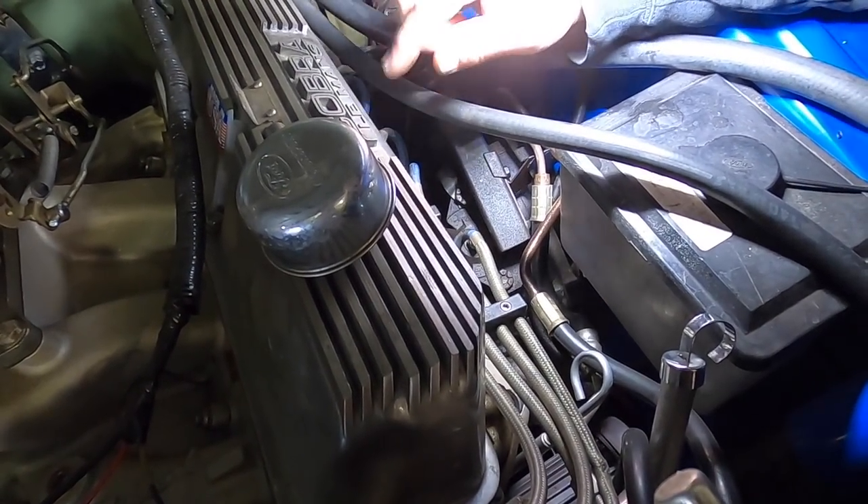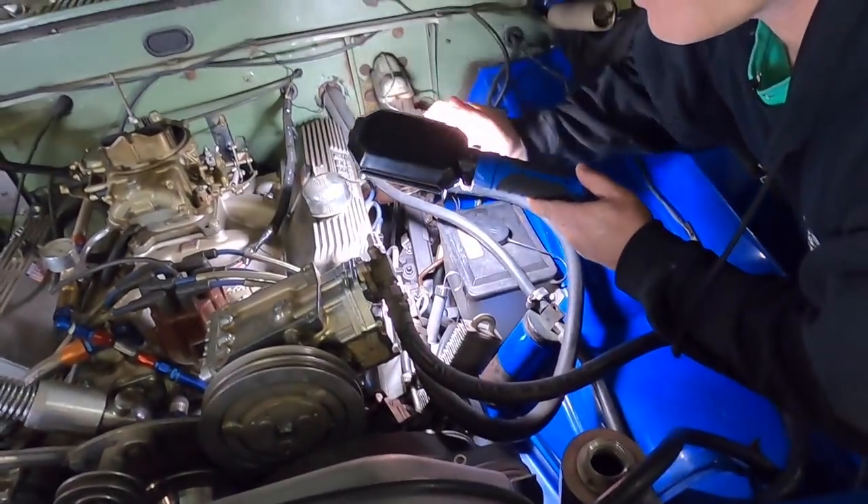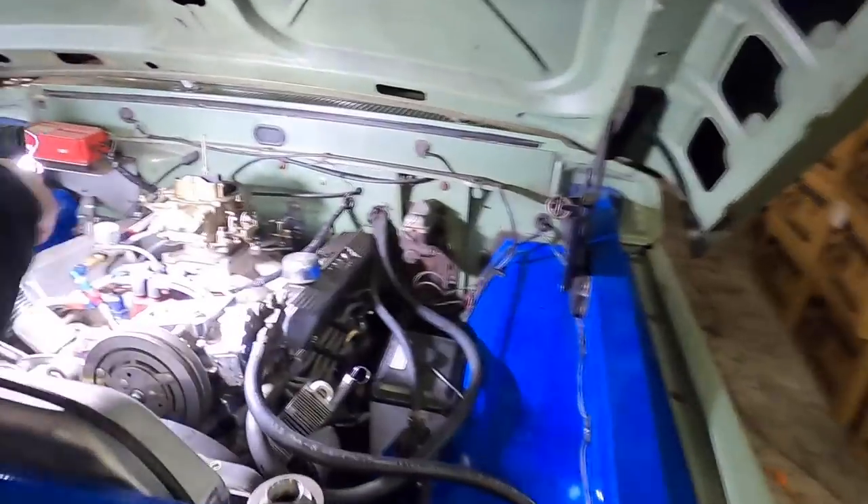Power steering pump's not leaking, but wait — we definitely have some power steering leakage over here. It's all over the place, though it's not a huge leak — it's a small steady leak that's been there a while. What we would do is clean it off really well with brake cleaner or engine degreaser, then drive it and watch for wet spots after each drive to determine where the leak starts, then replace that component.